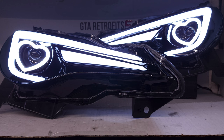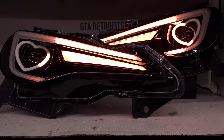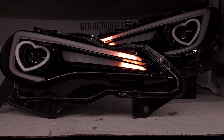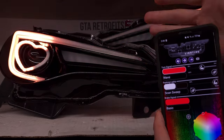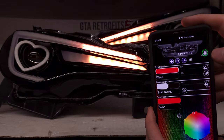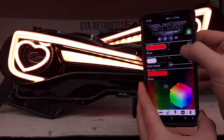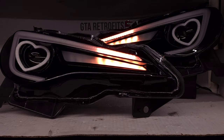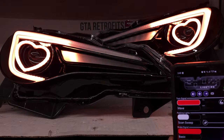Lastly, it's going to be the turn signal. Right now this is set up at a fairly good speed. The issue is all cars have different relays for the turn signals, so you will probably have to adjust the turn signal speed. The size is nice at 50% — you can adjust it; that's the size of the amber itself. But if the amber is too large, it may not be able to completely complete its animation, so you will have to adjust the speed. If we reduce the size, it has more of a flowing motion — maybe closer to 50% would be better. In my opinion, that looks good.